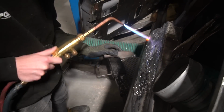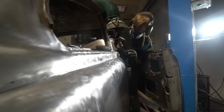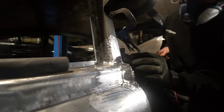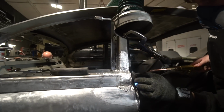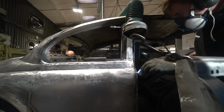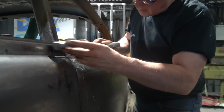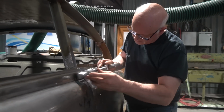A lot of lead around the place, catching all the filings on the floor, on the paper, or the bulk of them. Obviously we're vacuuming up, using our big shop vac to get rid of all the leftovers, so it doesn't get trodden all around the workshop and generally contaminate everything. And then the stuff that goes onto the floor, we then tend to remelt into ingots to use for any sort of heavy fill areas that we might need to do. All the impurities come out when it's remelted, and we can then reuse it.